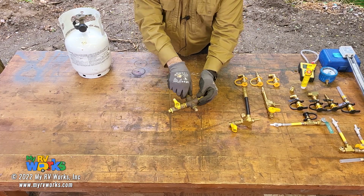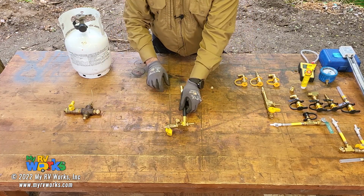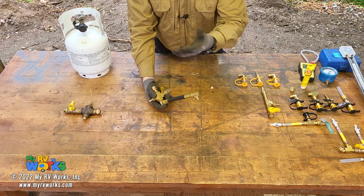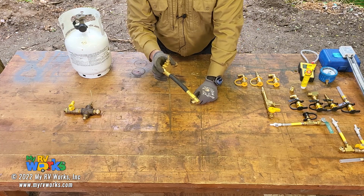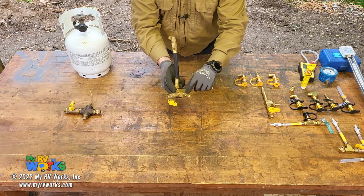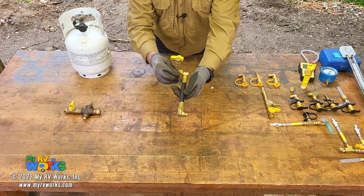Okay, so after I used this for several years, there were times where I could not get this into a spot. I just really couldn't get it in there, and it took a few minutes to connect and disconnect and everything. So I came up with this next design, and I felt, oh, let me use a flexible hose. Typically I like to do my testing at the refrigerator because it's outside, the cylinders are outside, it's easy to walk around back and forth, and I can tap into that 3/8 fitting, and I would connect this right at the refrigerator port. And it's the same thing: a number 41 hole, gas valve, manometer hose would plug in right here, okay? And so it's basically performing the same thing. It's still across, and here I would have a 1/2 inch male flare, and this was a 3/8 inch male flare. And so this allowed me to get the tool in to where I needed to work, okay?